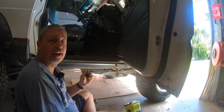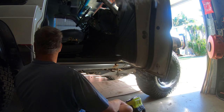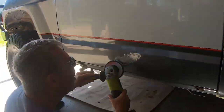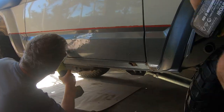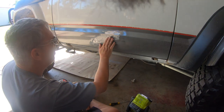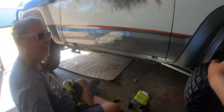What we've got to do is cut enough out to get to good metal so that when we weld the bit in, we don't have any issues. We're going in with just a flat. This one is going to have to come around the corner a little bit, and I think the other side does as well. This has got a slight curvature to it, but we'll be able to match that. Is there any other bodywork on this side of the car? No, that's stripe. Once you guys get the flares off that side, you can get the caramel wheel and pull off that stripe. So is this to try and assess the dent? Yeah, I've got a dent puller — we'll try and pull that dent. To do that, you've got to get back to bare metal.